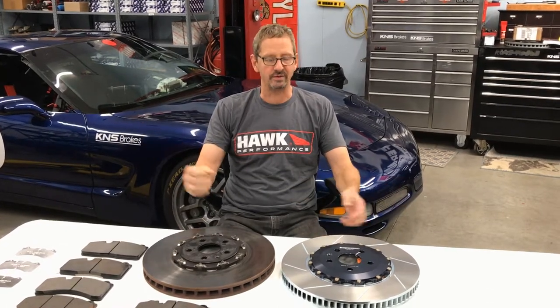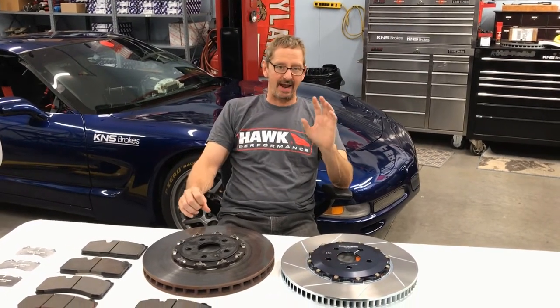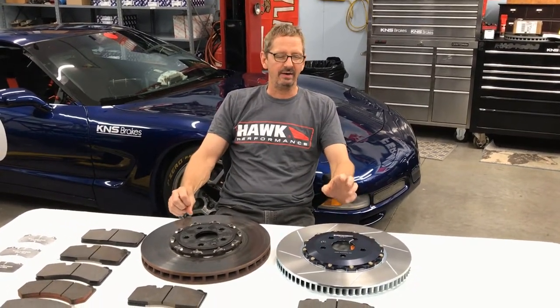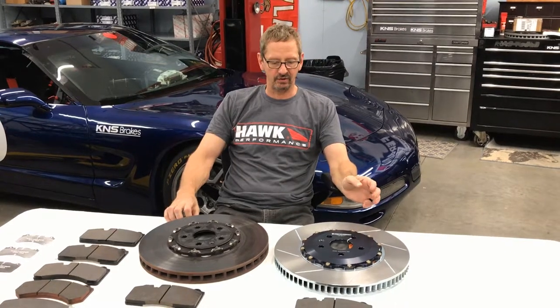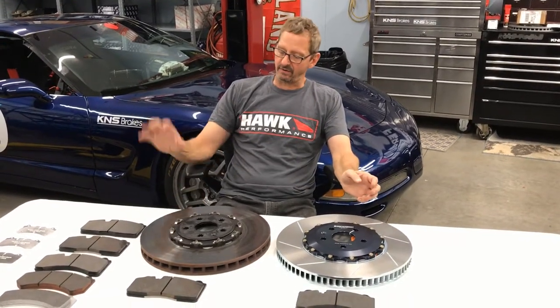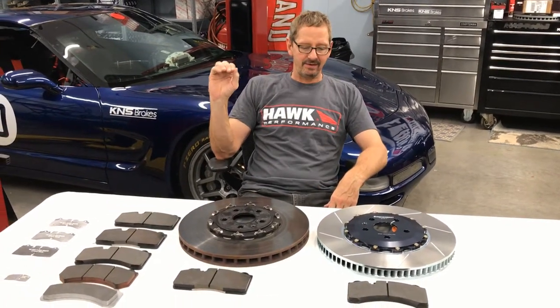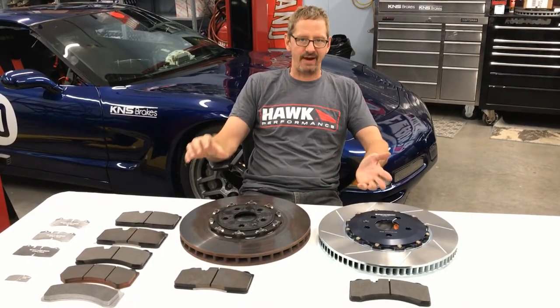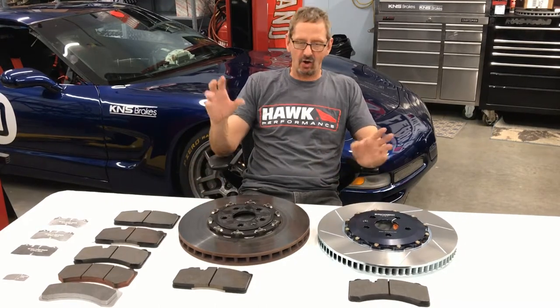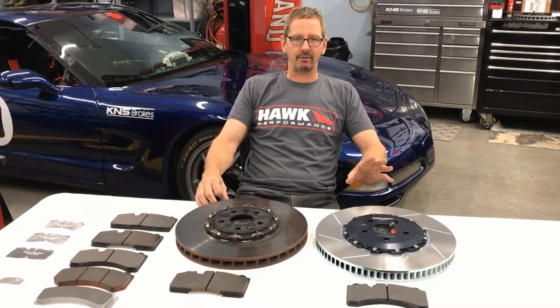As you know, it's big Brembo calipers on the front of the ZL1 and those calipers, pads, and rotors are pretty unique to that car. They might be on one of the Cadillac CTSVs, but as far as crossing over to other cars it's not really there too much, so there are a couple of things you may be interested in. The first thing of course is that it's a Brembo 6-piston caliper, and these calipers Brembo makes come in a whole bunch of different ways — a sort of a family — and in fact in their big brake kits they kind of call it the P caliper.